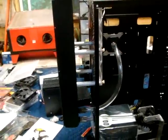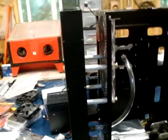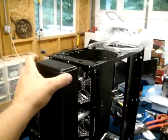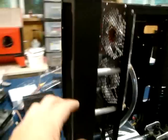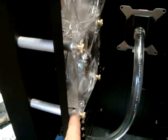I came up with a system for mounting any radiator to the back of any case, and I think it's kind of a pretty nifty idea. It follows the same technical idea as my water board that uses the tubes and the all-thread rods to compress it, and this is very, very strong. This isn't some wiggly radiator — as you can see, the whole case is tied to the radiator, and it's so simple, I just love it. Got four tubes, four little pieces of tube in between each fan.